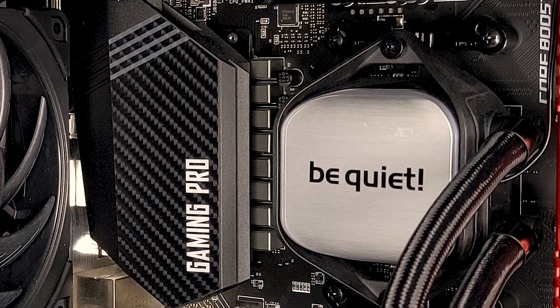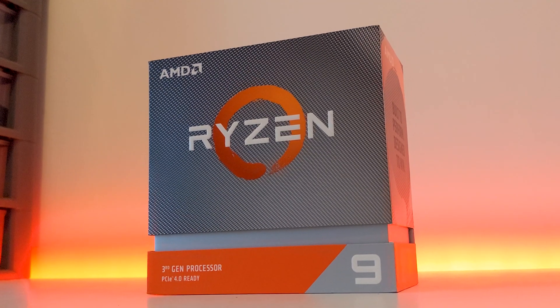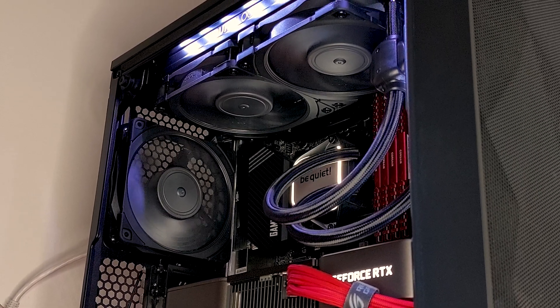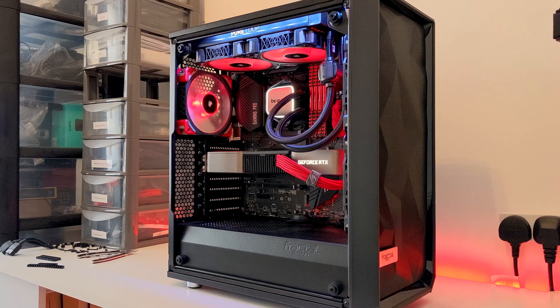For today's testing, we'll be using the BeQuiet PureLoop 240 AIO paired with the Ryzen 9 3900XT, which will be run in a stock config, but we'll be doing a multicore stress test which should give us a roughly 140 watt load to dissipate. All of this testing has taken place inside a completed system inside the Fractal Design Meshify-C with the side panel on and fans separate from the radiator, but these conditions remain the same for both Corsair and Noctua fans, which should allow us to run a fair comparison while keeping the environment exactly the same.